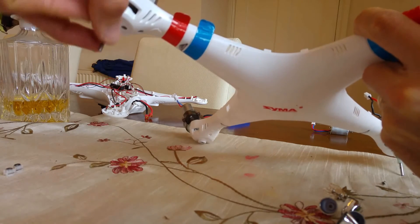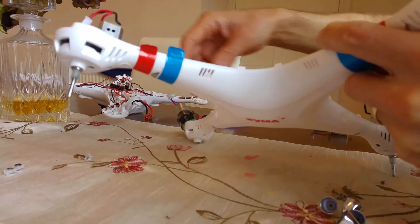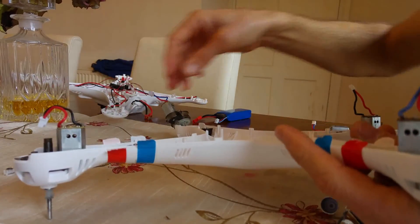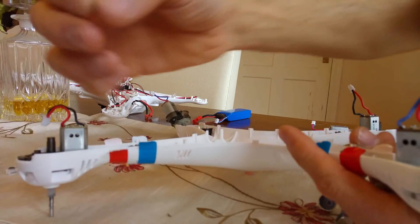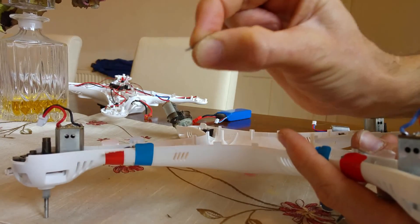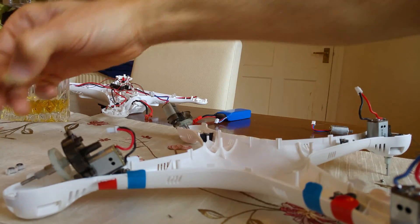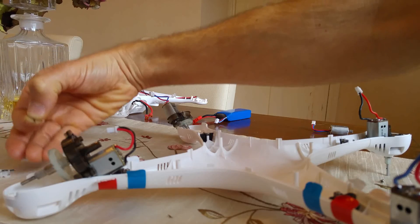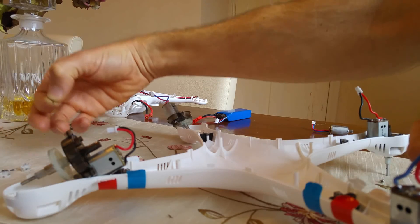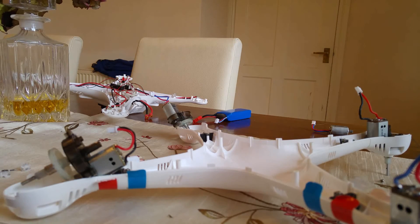And then in this shaft, there's a little hole, and you have these little tiny bits of metal that go through the hole. So you have to take that out, take the spacer off, take the cone off, take the propeller off. And then obviously the motor housing will come out entirely.